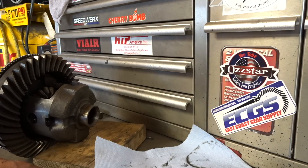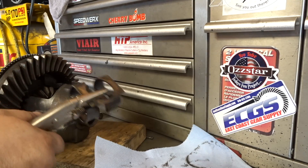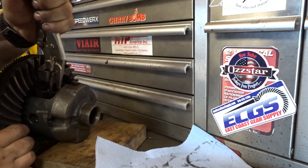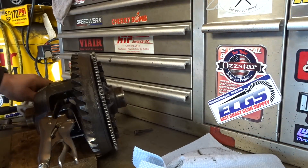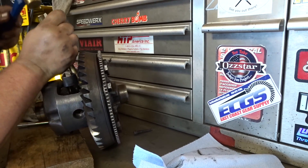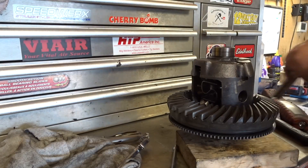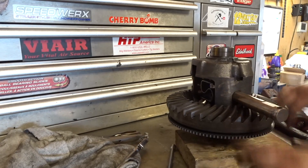Once again, if you want a more in-depth look at how to get the S-spring in, I have one listed in the playlist and I'll try to put a link in the description. Basically, you just take your needle nose channel locks, clamp it, feed it in place where it's going to go, then tilt it back and give it a couple good wraps with the hammer — you'll see it kind of go in. Then if it doesn't go in straight, just tap it around with the brass punch to get it aligned, tap it down, and once you get it past the gear it'll really drop in easy. Get it down in place.